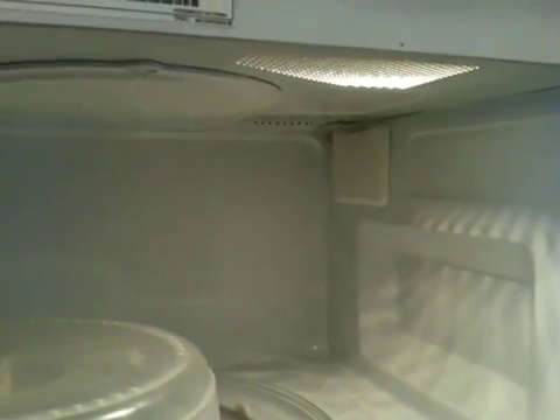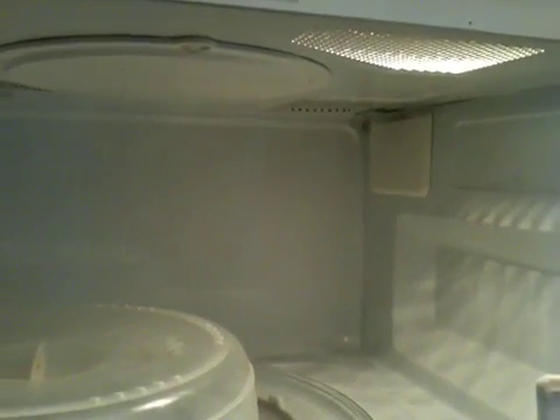What's happened is a light stain — anything could have got on here. My wife's going to be real mad because you'll think that our microwave wasn't clean. Well, this is as clean as our microwave was when it caught on fire. It's not really dirty. What happened was something had splattered on there, a little stain, and the microwave energy was going through that stain and heating up and eventually caught this plastic on fire. And once the plastic was disturbed, it obviously caught on fire and burned up.